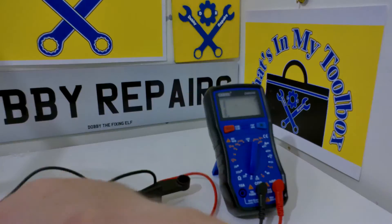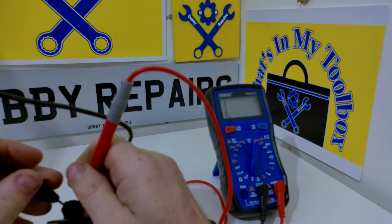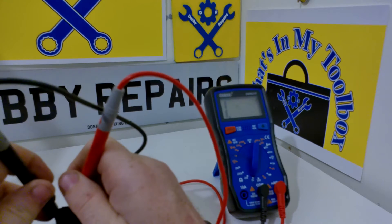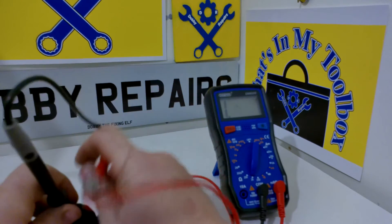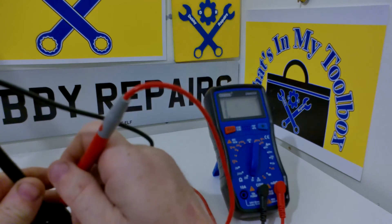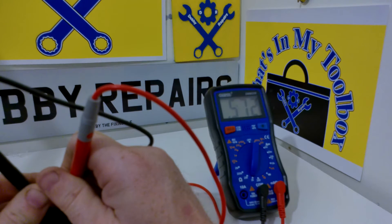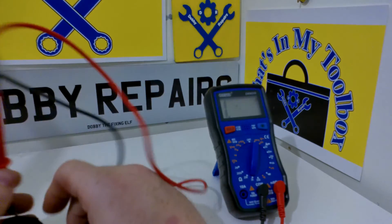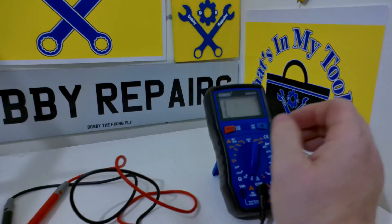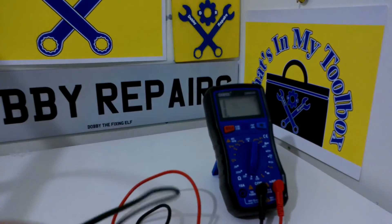If I probe in here — there are quite small, delicate pins in here to find, and I have a camera in the way which makes it slightly more difficult. Get that one on first and then we'll get that one on. As you can see, we now have a resistance reading of 570 ohms. And that's how you check the resistance — this is a perfectly good sensor. That's always good. That was a slightly more difficult one.